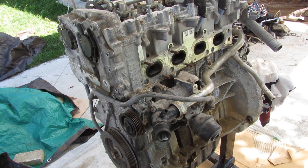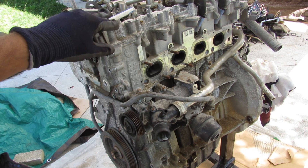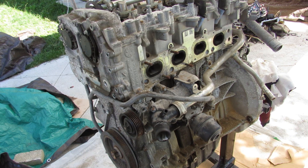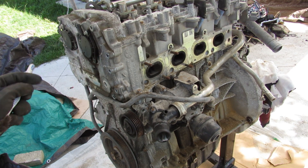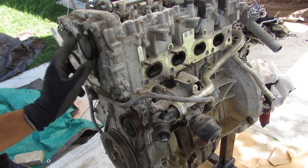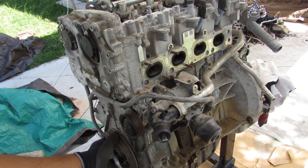This engine is all made of aluminum including the oil pan, the block, the heads, the timing chain covers, and even the valve cover — which is great because there's no use of plastics or heavy steel. Looking at the motor from the front, we've got dual variable valve timing controlled electronically through these oil control valves. You've also got the accessory drive off the crank pulley.